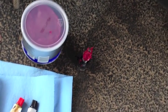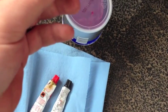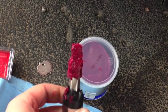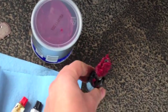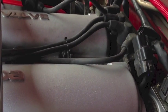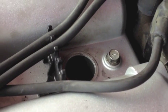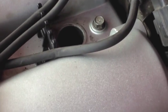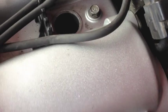You can see I've already set up the tap here, I've already greased it, because you want to be able to pick up as many of the metal shavings as you can. In this case we're working on the number four plug, so it's the back-most hole, and we're going to pull out the spark plug first and go from there.